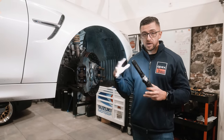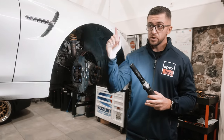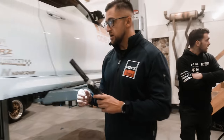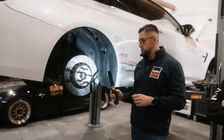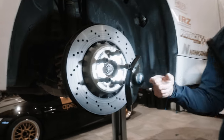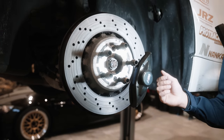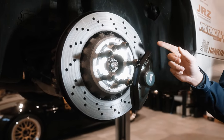That's why you have the mechanical distribution of brake bias — bigger brakes on the front compared to the rear. We can quickly look at the back ones, which are smaller. It's not just the overall diameter; it's more the surface area and the caliper piston size that matters. You can see here there are just two pistons — one on the outer side, one on the inner side — plus the brake disc size is slightly smaller.